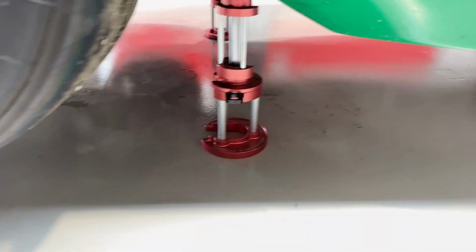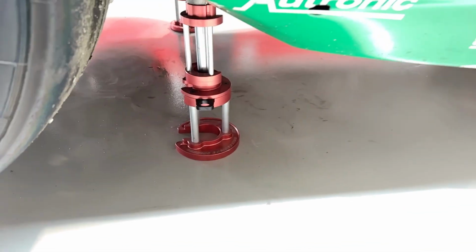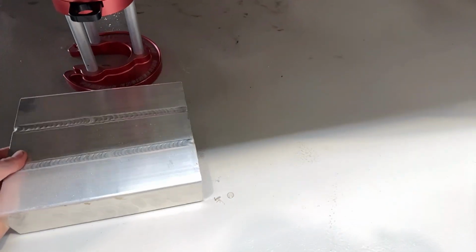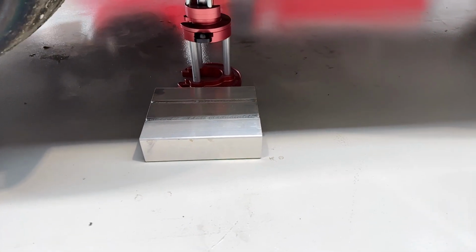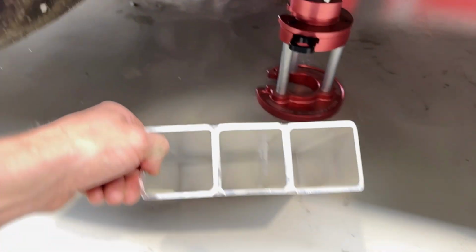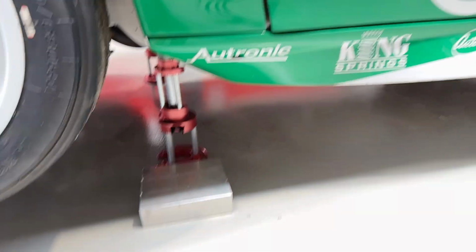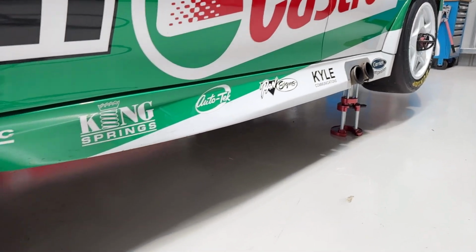If you wanted to go higher, you could put the old trusty block of wood under there, or Perkins Engineering have actually fabricated aluminium stands for a lot of the current supercars teams, including Walkinshaw Andretti United and Blanchard Racing Team. So we would cap that in with aluminium sheet, but it's basically a nice strong base. We put some nice little handles on there, and you could use two or three of them and get the car even higher again. So that's how you jack them up.